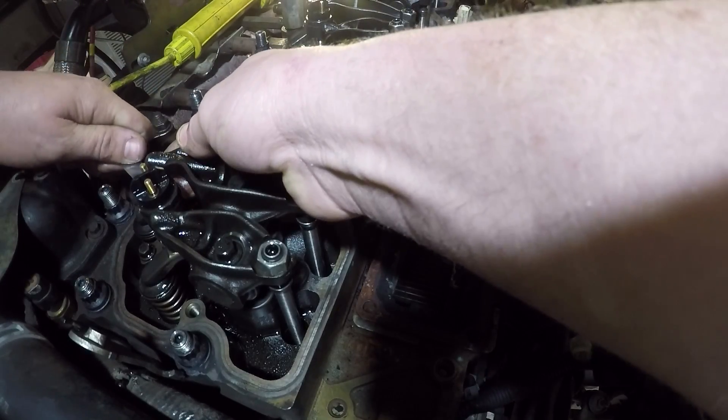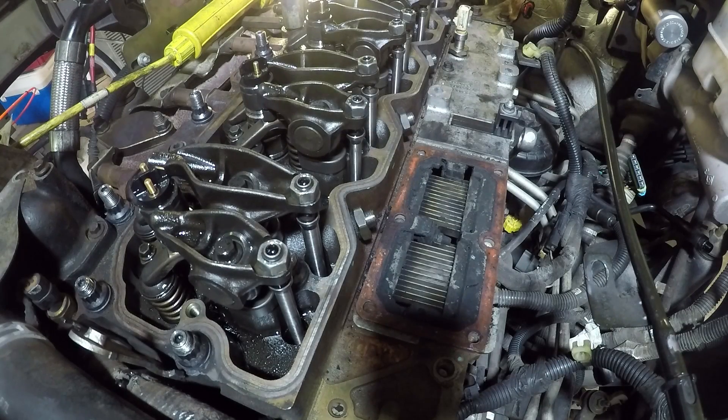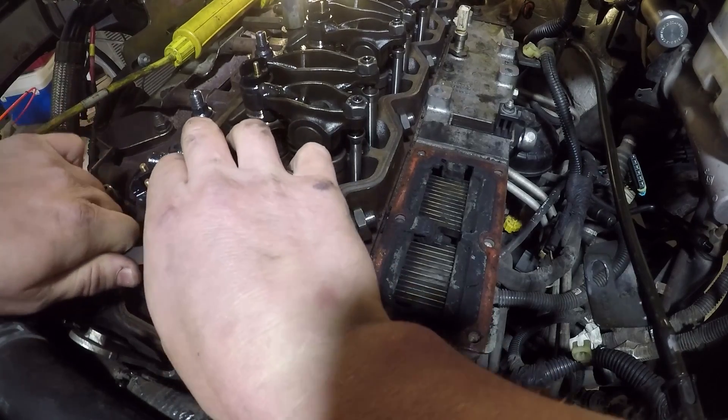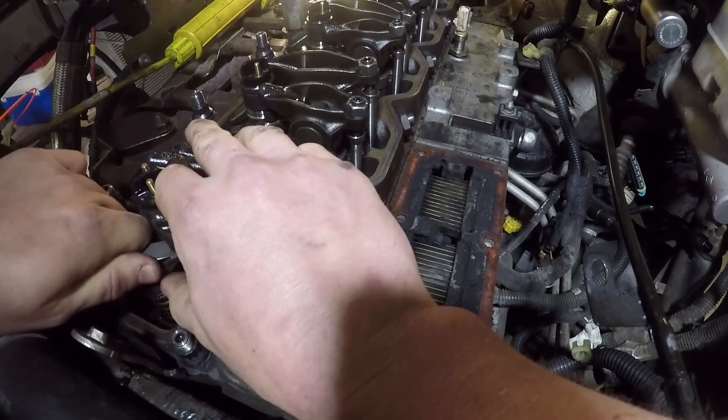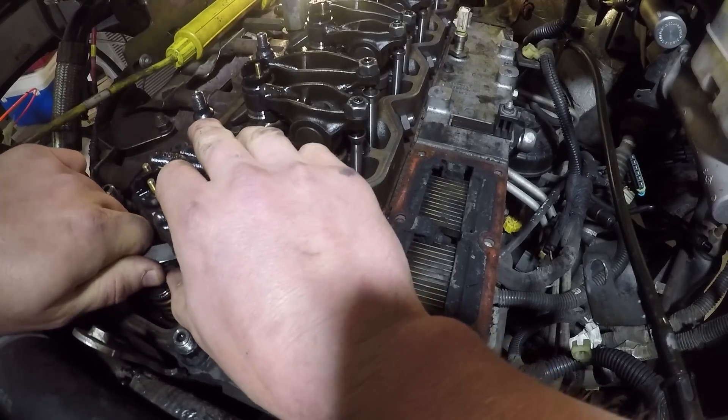We'll check it — see if we can slide it in. It's tight, but we can get it in. That tells me we're pretty good. It's within a thousandth or so of what we want, which is kind of ideal. You're not going to get it exact, and when you're working with feelers, it's all by feel — my feel will be different than somebody else's. Here's an 11 thousandths feeler — that goes in a lot easier, so I'd like to tighten that up.